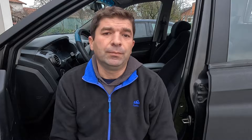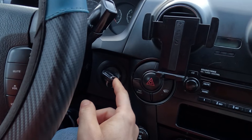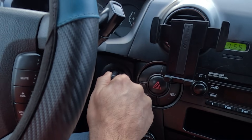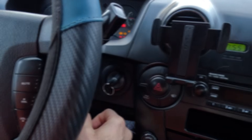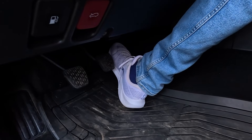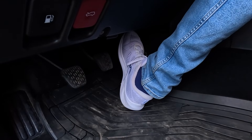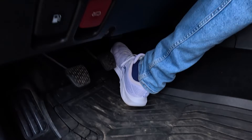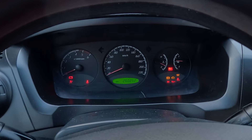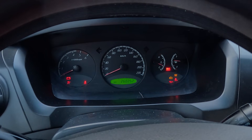Here's a common one. Start by turning the key to the off position and leaving it like that for 10 seconds. Then turn the key to the on position and leave it for 3 seconds. Fully press and release the throttle pedal 5 times within 5 seconds, then wait 7 seconds. Finally, press and hold the pedal down for 10 seconds. At this point, the check engine light usually begins to blink, which tells you your ECU is in diagnostic mode.